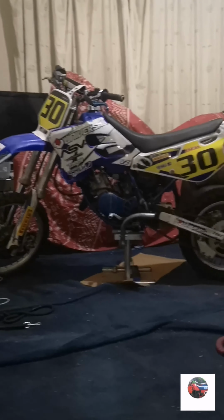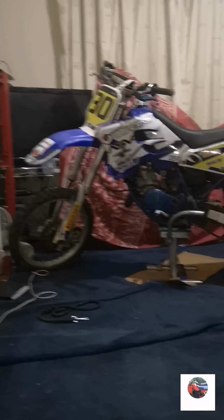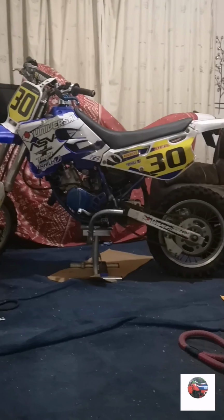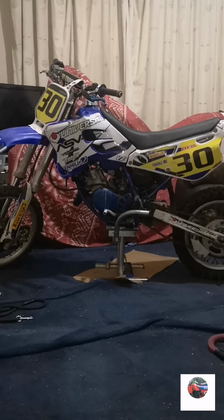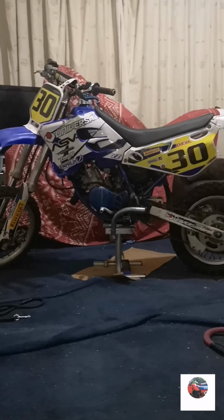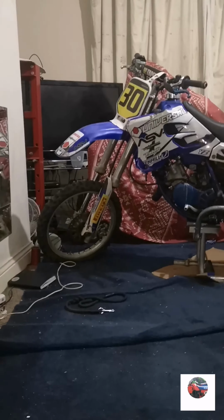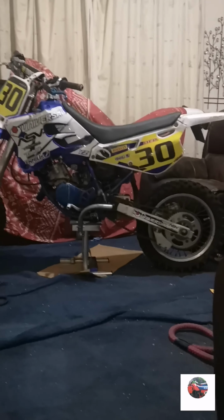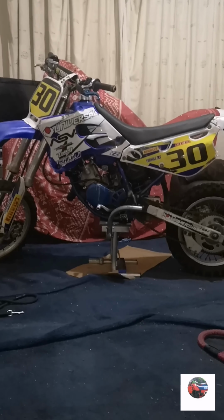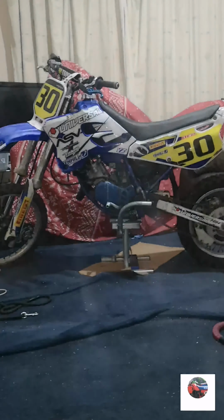And in this video I've got this YZ80. I think it's a 1997, but 1993 to 2001 are all the same on the YZ80s. It needs a top end rebuild and a bottom end rebuild, the crank and the main bearings are gone, and the back brake bearings need doing. It's either the front caliper or the back caliper pads that need putting in, but I'm going to get all these panels off, the tank off and everything, drain the oil out of the engine and drain the coolant out of the radiator.